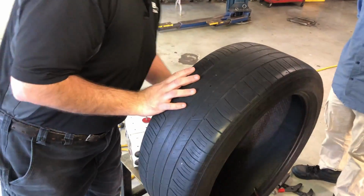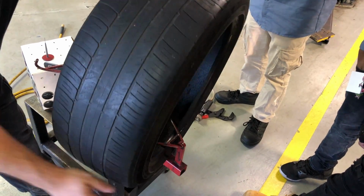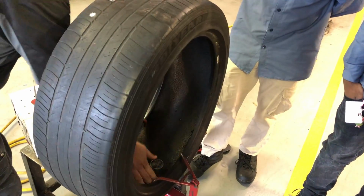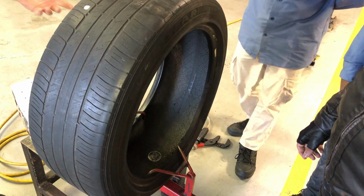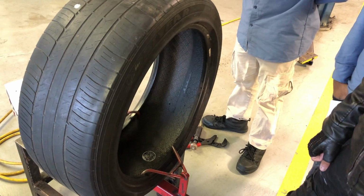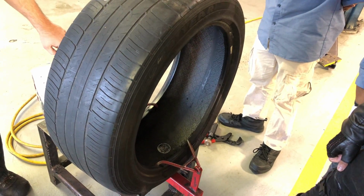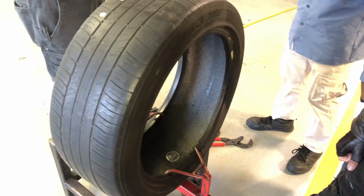Now, I'm going to flip the tire so that the hole is down. There's my hole. See how I can see straight through? All right. So the first thing is, remember this liner or casing. Its whole job in life is to seal what in? Air. So it's got a coating on it that's non-porous and kind of slippery. Sticky, no stick to slippery. Okay? So our first step, this is called a tire buffer.